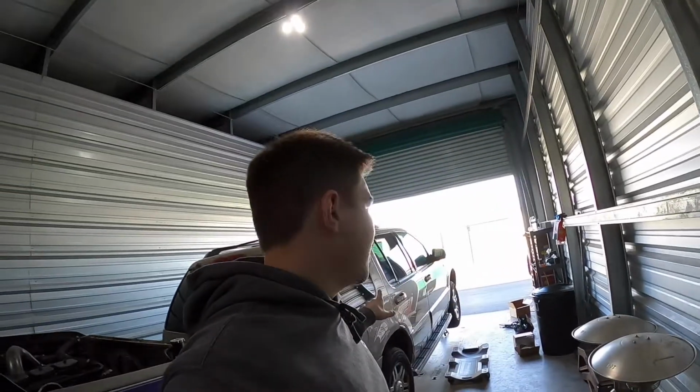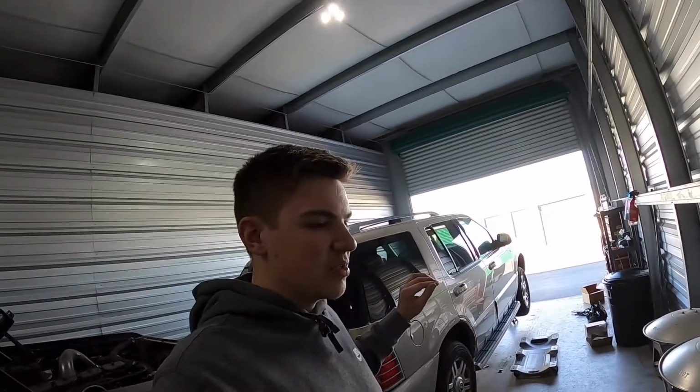This particular vehicle has had the catalytic converters replaced on it, I think twice, and for some reason they keep clogging up. So I honestly think that's what the issue is, because it's very quiet, it sounds weird, it sputters, and it screams, but it just can't get the exhaust out, is what I'm thinking. So I'm gonna let this thing cool down for about an hour or two, and then try to pull the downpipe off and see how it runs with the downpipe off.